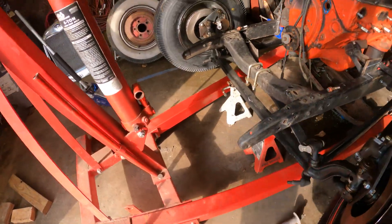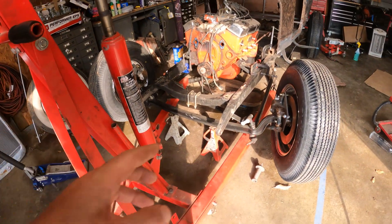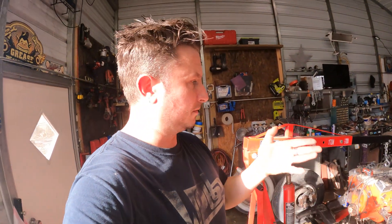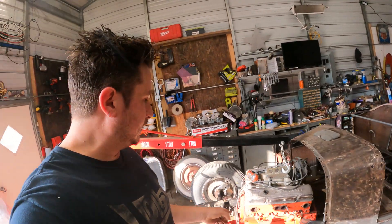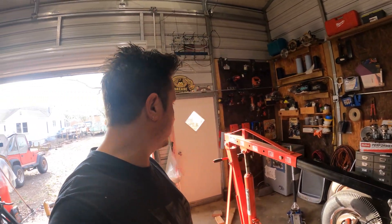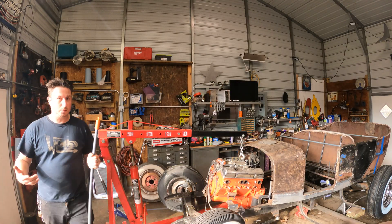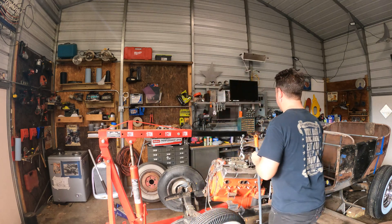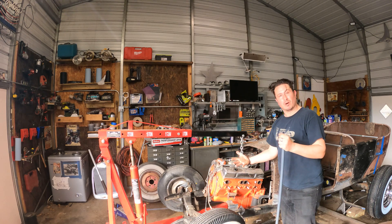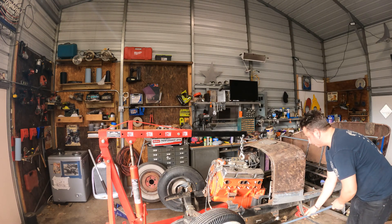The cherry picker's in and under the thing. I had to jack up the front axle because the floor jack wouldn't slide under. So here we are. Time to get the weight off this engine, pull the bolts out on the engine mounts, and just ease it up and out. So this is one of the downfalls of this type of engine grabber. I've hooked it on the back hole because that should make more of a balanced situation, but obviously I cannot level the weight out on this thing — it is whatever it is.